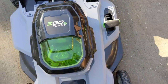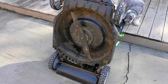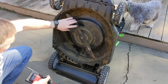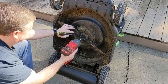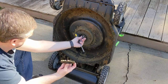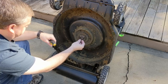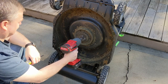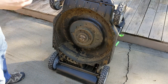The first thing I'm going to do is take the blade off. After removing the battery, we don't see anything that would be causing binding or making it harder to turn than usual, but I'll go ahead and remove the blade. It's right-hand thread so just lefty-loosey. Nothing is really binding; it all feels free to turn. We'll put the spacer and bolt back in briefly — yeah, no problem there, nothing binding.